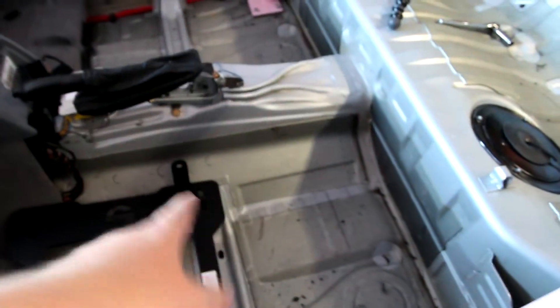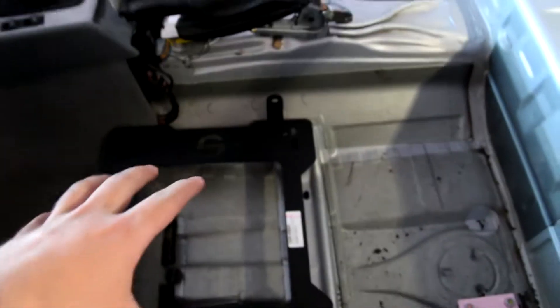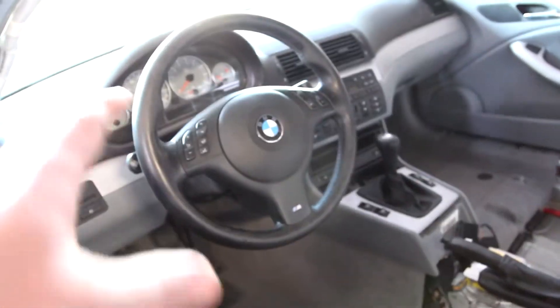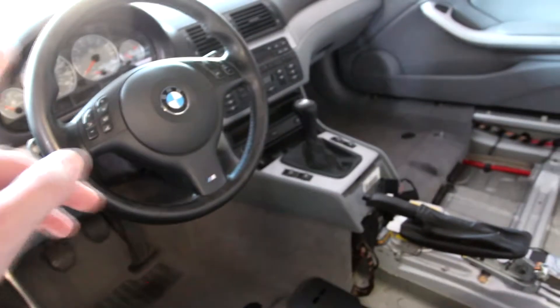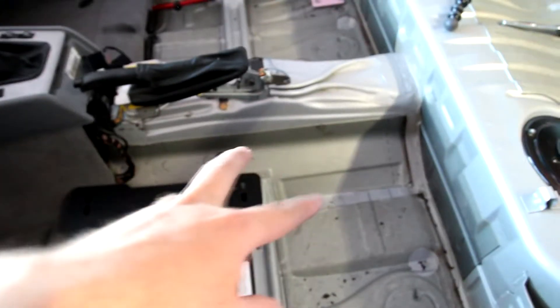Realistically, I want to do the harness before I do the seat because I still need to drill holes for the harness down in the floor. But where the harness is going to sit depends on where I'm going to sit in the seat. So we've got to get it mounted up here first, get the right seating position, then I can know where to drill the holes for the harness, mount the seat with the harness, and then the whole thing should be done.